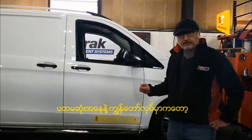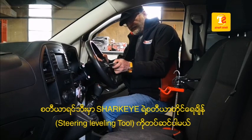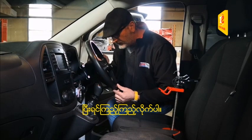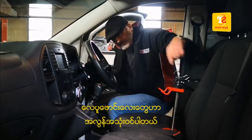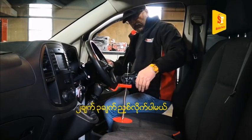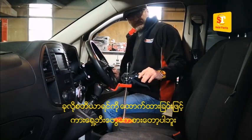The first thing you do with the kit is put the steering wheel clamp on. The car's on the ramp, the slip plates are open, and the turn plates are usable. First thing we do is put the steering wheel levelling tool on. There's a little bubble on these — very good — and according to that, it's level. Quick check of the eye, yes it is. I'm using our premium steering wheel clamp to lock it off. A couple of pumps — it doesn't need to be too secure, just so it doesn't move. We're just locking the front wheels in place for the moment.